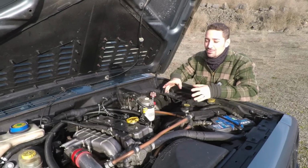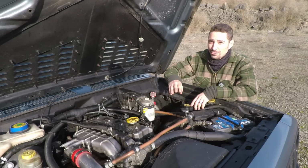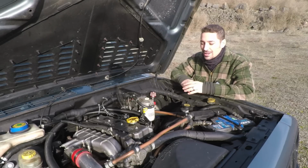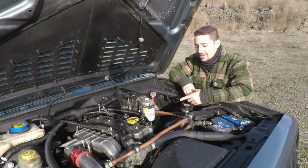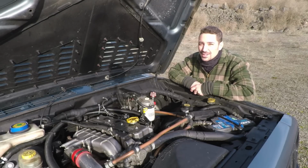This is the Mark II of the engine, the latest one from my knowledge, so it's a little bit different on this. If you take one cylinder head off, you disturb the others and they all need to be removed, new gasket, and it all has to be done. There used to be a separate gasket for each cylinder head, but those days are generally over and they were weaker anyway, so people did away with them when they could. Now they use a multi-layered gasket and you never really get any kind of head gasket issues.